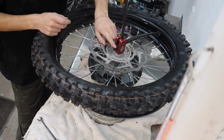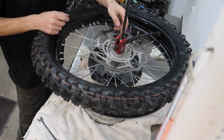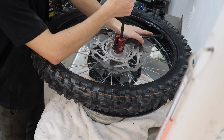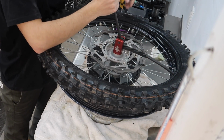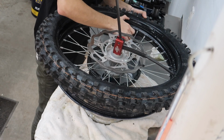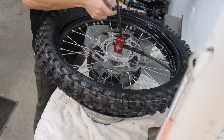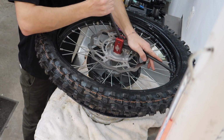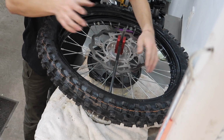So I have it maxed out to the end here on this bar, or the gears here, the lever to split, and it pushes the tire pretty much right into place. I might have to actually pull this back a little bit, or try now to put the rim lock in. Kind of start roughly at the rim lock and finagle that in before you push the rest of this on here. So basically, it's not too hard. Pushes right into place.